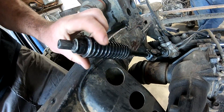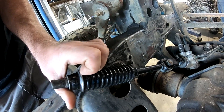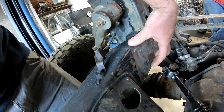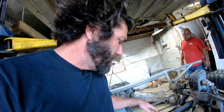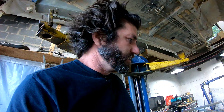Something else I'm going to keep my eye on is this intermediate steering shaft. It was sitting at about an angle like this; it's going to fall down more like this now and I'm going to have to lengthen it. The mount was really close to it already and it's going to move two inches back now. If that steering shaft isn't in the way, I'll probably opt to use the Tundra brackets and engine mounts. But if it is in the way, I might be forced to use the Tacoma mounts — they're a little smaller, give that thing more room. We won't know until we get the engine set in there.